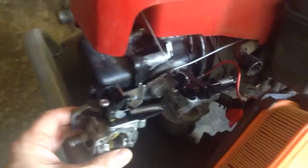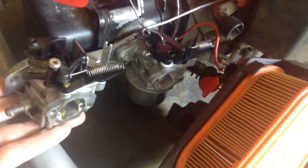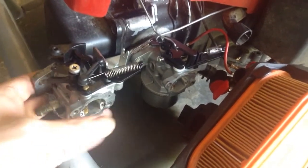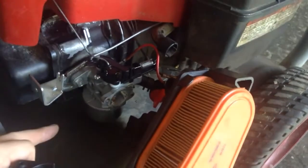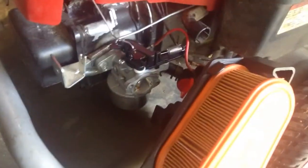This one had to have the carburetor replaced. Here's the old one and there's the new one. Do you see anything right off the bat that's not right with this picture? The fuel inlet — where the fuel line plugs on — is 180 degrees on the wrong side on the new one. But I was able to make it work with this Frankenstein fuel line. Make sure you get the right carburetor — that helps. I didn't order this one, but hey, we made lemonade.